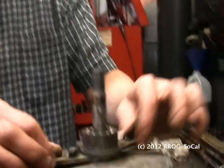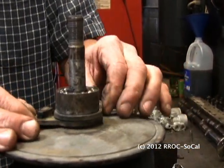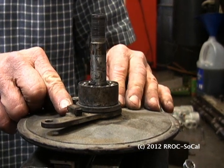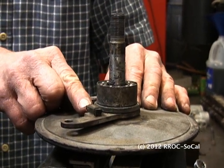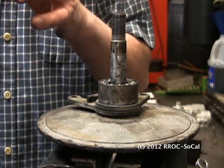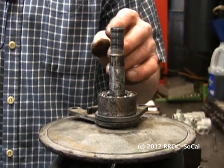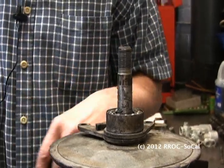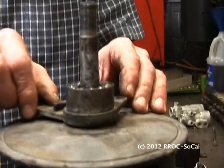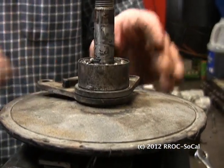You see this one for the reverse — it's got a little rubber stop on here. What that's for is going forward it's okay, but when you back up and let off the brake, if this rubber's gone you hear a clunk-clunk every time you let off the brake — that's because this rubber is worn out. It doesn't do a nice soft return that way.